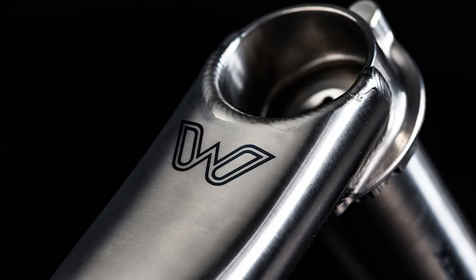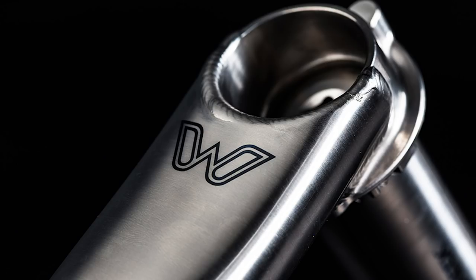That 10-year warranty claim is backed up by the fact they cost $999 for a set. But offsetting that with a 10-year warranty on titanium cranks, it could be the last set of cranks you ever need to buy. They're compatible with X-Sync chain rings, and with a 30mm spindle they take BB30, PressFit 92, PressFit 89.5, PressFit 30, and 392 EVO bottom brackets. The machining on them is just unbelievably nice - I did not see that crank coming from Cane Creek, and I think it's one of the nicest set of cranks I've ever seen.